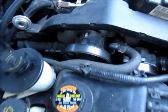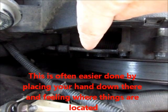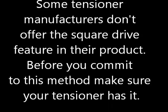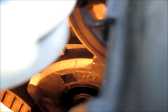On this vehicle it is difficult to get at everything. I'm going to show you where the tensioner is located. Looking in this direction, the tension arm is right down there on the back side of the power steering pump on the inside of the belt — that's where you're going to go with your tool. Looking at the tensioner through a very small opening between the power steering pump reservoir and the coolant overflow reservoir from the passenger-side fender, you can see the tensioner, the square drive, and just below it the mounting bolt, which is a Torx bolt for the tension arm.